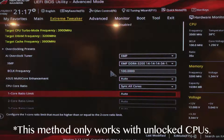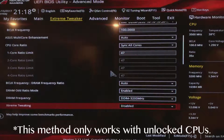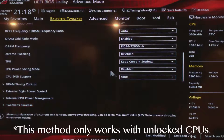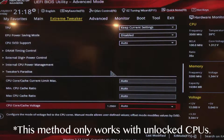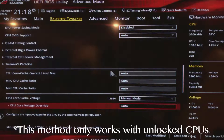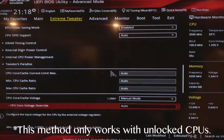The second thing I needed to change was the multiplier of the processor, and to also make sure that all the cores were running in sync. When it comes to the CPU voltage, you want to make sure that it's set for manual or fixed, to make sure that the voltage doesn't fluctuate so that the system is stable at all times. Last but not least, the voltage or the CPU V-core needed to be set for 1.4 volts or below.